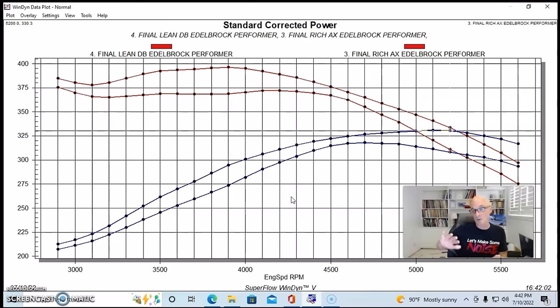I mean, it dropped the oil pressure almost immediately on the load in, still about 80 pounds of oil pressure, same as it was before. But all during the run, it did nothing but drop. Now, when I say drop, it dropped down at 5,500 RPM. We still had 55 pounds of oil pressure, which, at the rule of 10 pounds per 1,000 RPM thing, that's still probably okay. It's just that I don't like to see a falling oil pressure curve.